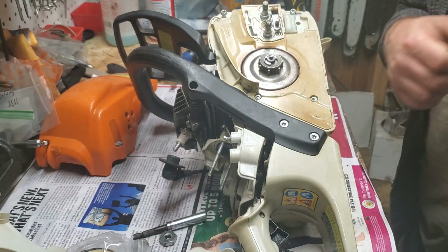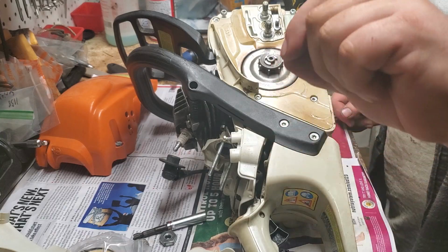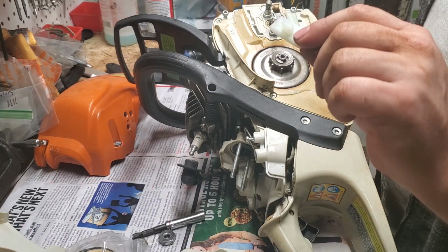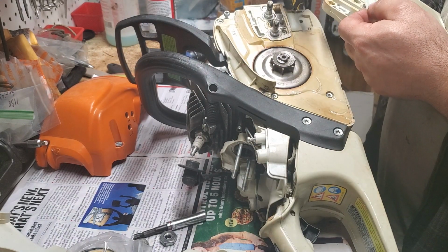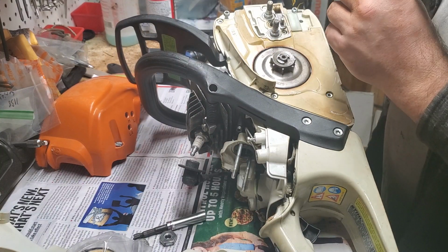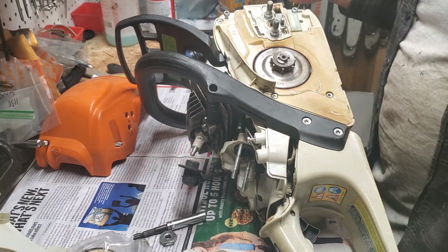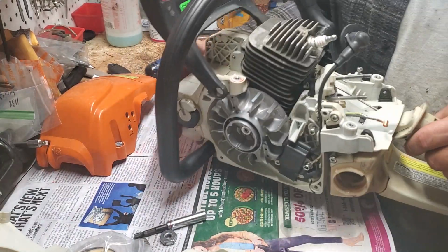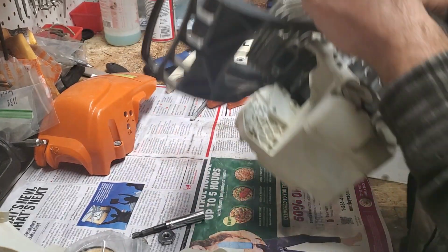And honestly, you guys, a little trick. If you're doing your own saw, and either you don't have access to these, or you don't want to pay the $1 something a piece that STIHL's probably charging for them, and you don't want to pay $6 to have 2 98-cent aftermarket ones shipped to you, super glue, whatever, these are really just a stop for your chain. They're just to help your chain from rolling off and hitting stuff. And so once your clutch cover and everything is assembled, just super glue them in or whatever. Again, I'm not recommending it. I'm just saying a guy at home doing this by himself to his own chainsaw could do that. Especially don't do it if you're a small guy like me selling stuff. I would never super glue these in on a saw I'm selling. That would be silly.